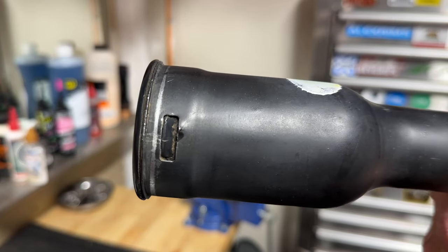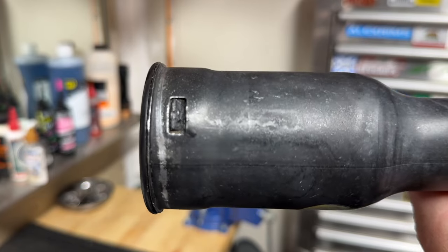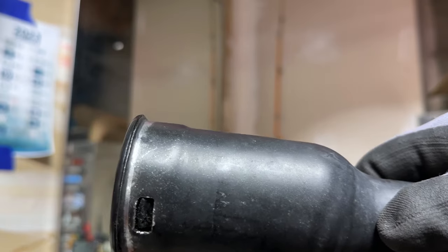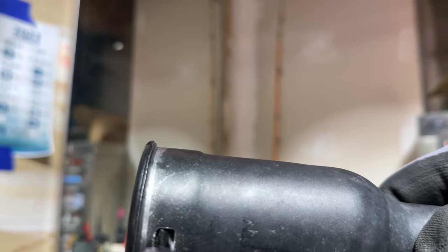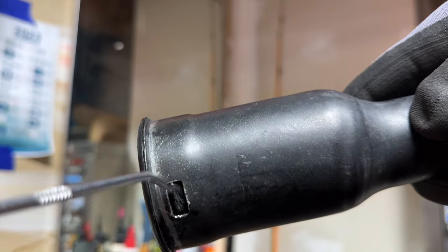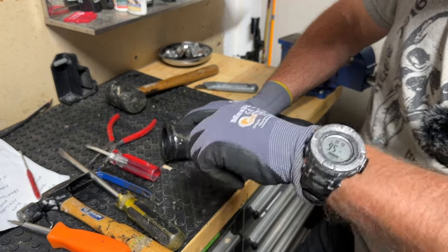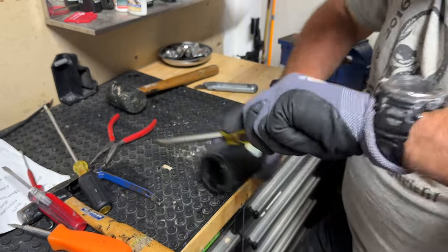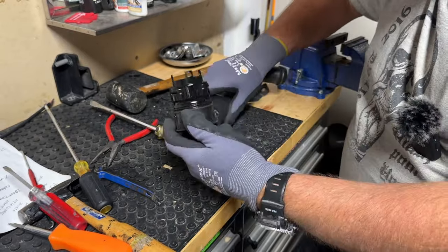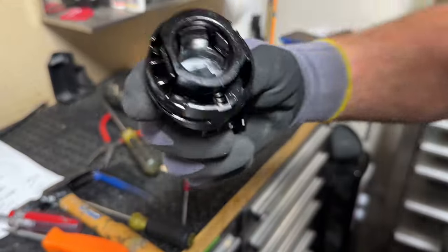This is all metal — there's a tab on this side and a tab on this side. I tried a bit and distorted it slightly trying to get it out while it was still connected in the vehicle. I wasn't having much luck getting this collar with the tabs out of the filler tube, so I tried a different approach. You can see this is the plastic tab here, and this metal holds it in. I stretched this metal out because the plastic tab was digging into the metal, then I got a small screwdriver in and progressed to larger screwdrivers, prying it out. It's definitely moving now — there we go. There it is. You can see some tabs right there. So there we go — that's what they call a discriminator.